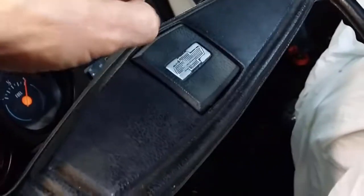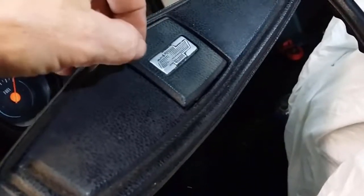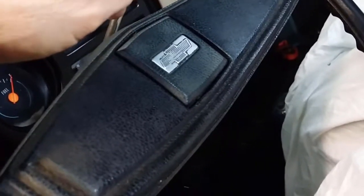Number everything as you take everything off, and have a paint mark on the top and on the outside of the housing, just so that when you put it back together, everything lines up. Also, when you're testing your indicator and horn, make sure you reconnect your battery to the car electrical system. Also, with the horn, just make sure that it's all assembled, so that that metal bit and the lock-in mechanism are all together before you put the steering wheel on.